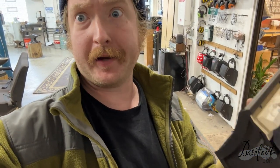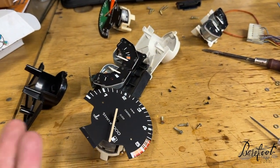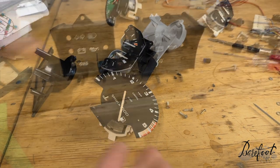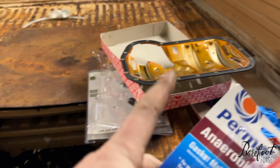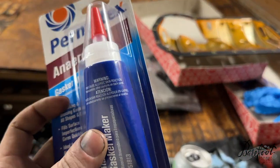Next up on the Doka project we're gonna put in a diesel super-rare diesel tachometer. We're gonna pull this out of this 1982 two-year-only turbo diesel Jetta. I want to know how fast I'm going because I'm definitely going to blow up this engine - I have no concept of what it's capable of, so we need a tach. This is a little more involved than I thought, but I'm just ripping them all apart. Switching out to this one - it's got that for the glow plug circuit. We're gonna use some Permatex anaerobic gasket maker, just a thin smearing on both sides to make it nice and tight.